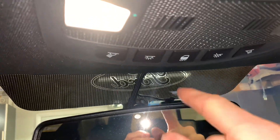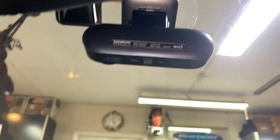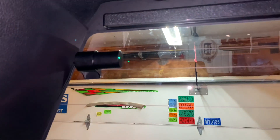Take those two bolts out, then you can lower this corner of your headliner and run the cord underneath, with the cord coming out right there. It's all installed now — I got everything back together, plugged in, and it's in parking mode and recording. If I switch it over to the other mode it'll shut down, and then if I switch it back to parking mode it'll turn on on its own and start recording.